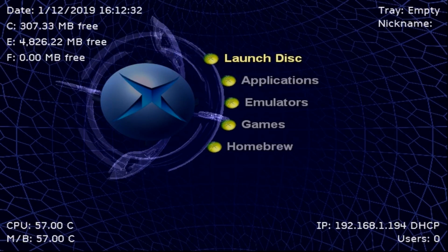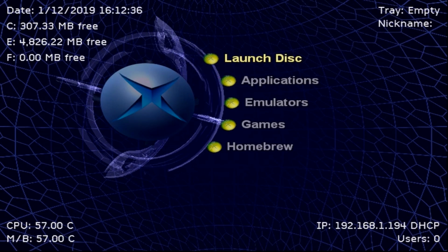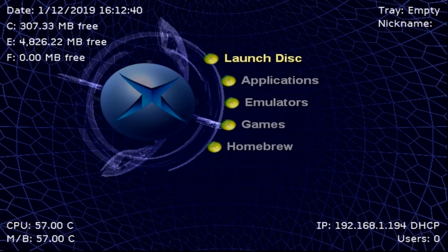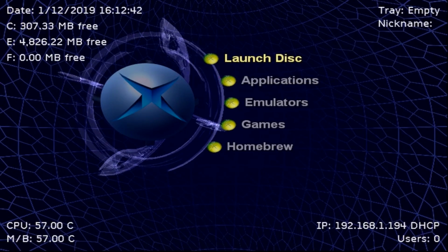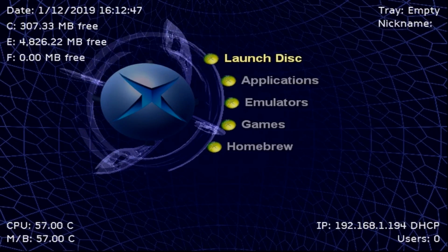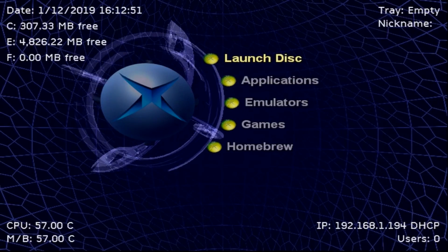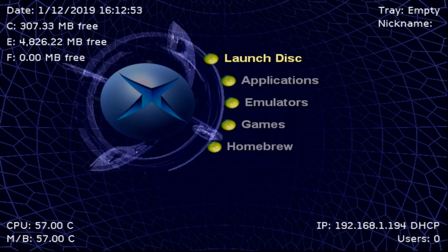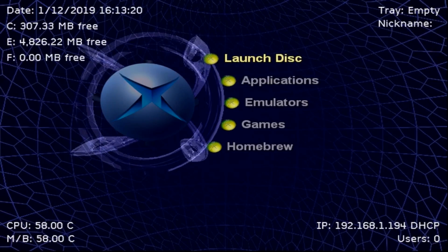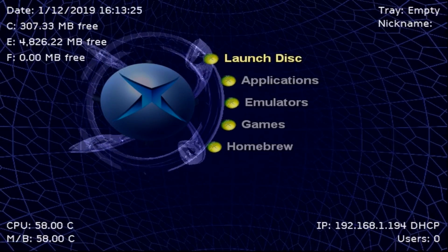If you're unsure how long to wait, 5 minutes at minimum. And then, once a few minutes have passed, in this case, again, let's say 5 minutes, what you're going to need to do is perform that hot swap. So very carefully, but somewhat fast as well, unplug the IDE ribbon cable from your DVD drive and plug it into your second hard drive. I just finished doing that, went over to my system, swapped it over, and I got it down to 2 seconds. So it's not too hard to do.